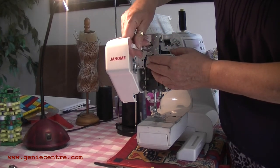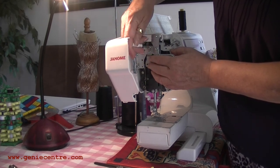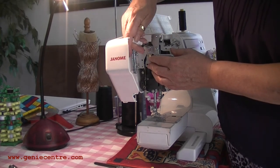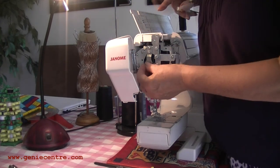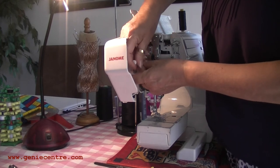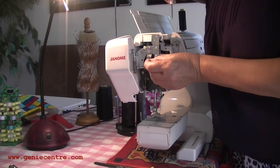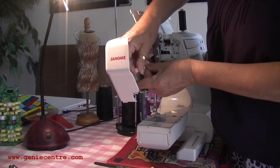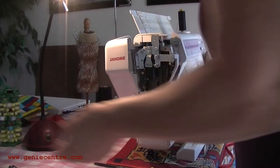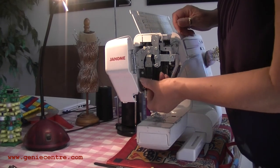You can see it's actually not a really difficult thing to do. The first time you may find it takes a little bit longer because you're getting used to how everything works, but all I really had to do was undo four screws to get the metal plate off, then one or two screws to undo the casing that holds the bulb so you can release it, secure it again, and then put in the new bulb. Hopefully this one will last more than two weeks.